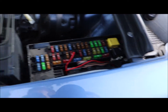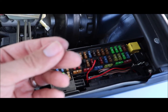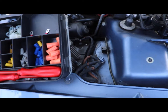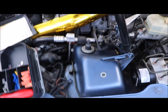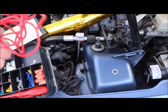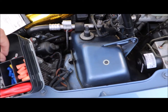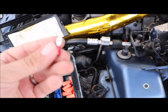What you're going to want to do is pull the fuse out. You're going to have the red 10 fuse cover. You're going to want to turn it around, and then make a connection with that. You're going to use the red wire — on both sides you're going to make two separate connectors. You're going to strip the metal wire back and set it onto these.